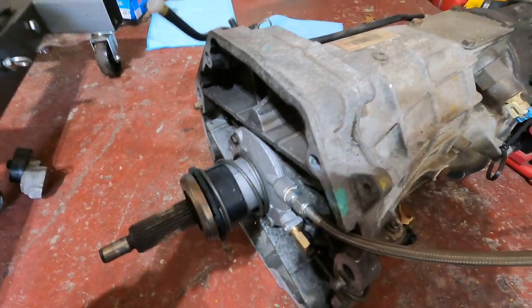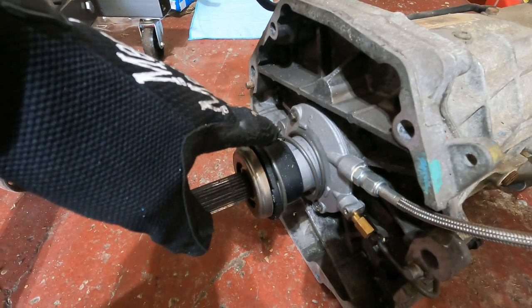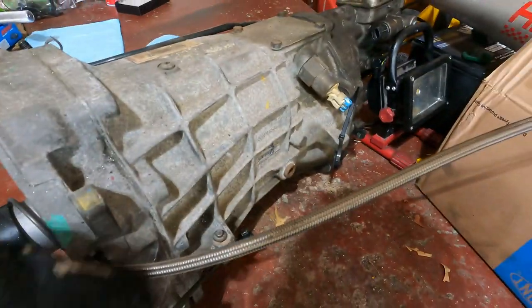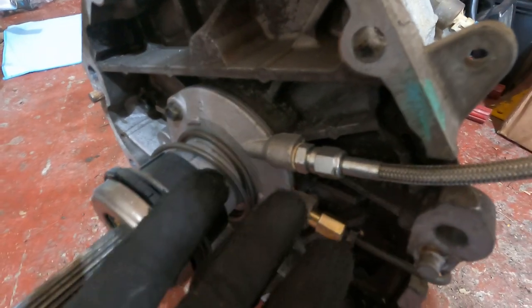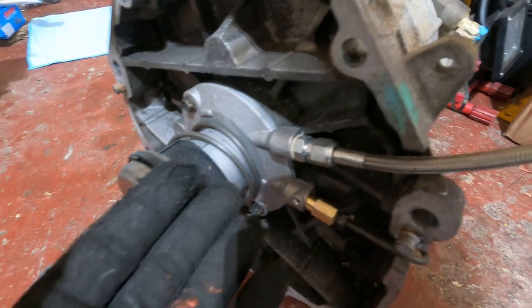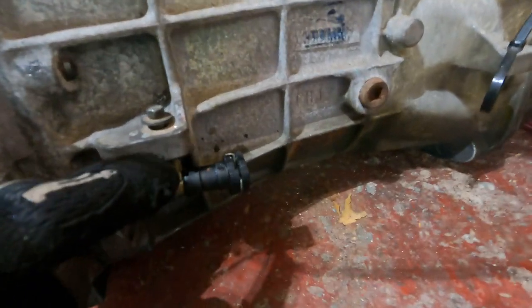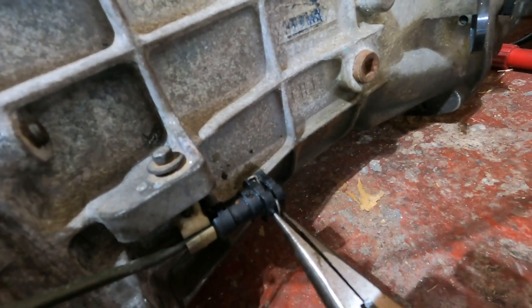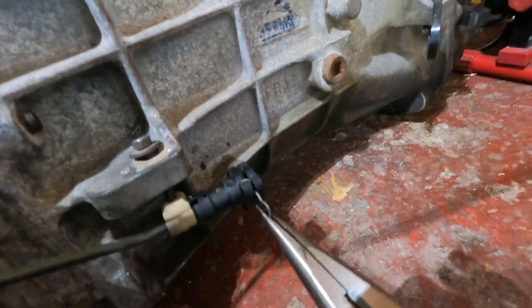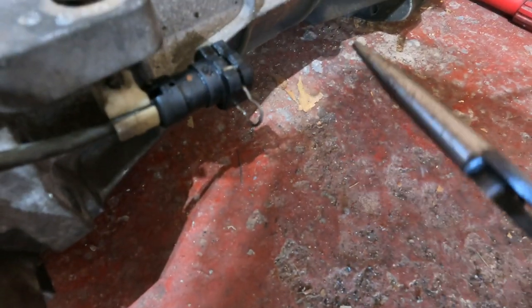One of the first things you got to do is drain the master cylinder. If your transmission is still in the car, this is still achievable. You can do it one of two ways. One, I have a remote bleeder line, but the only problem with that is it's higher up in here, so you're not going to get all the fluid out - which is fine. You just want to get it out of the master cylinder. You also have to disconnect the master cylinder from the slave cylinder itself. Just get a needle-nosed plier, pull it down, and it should look something like that - a little snowman popping up - and then you can pull the line out of it and it'll drain out.